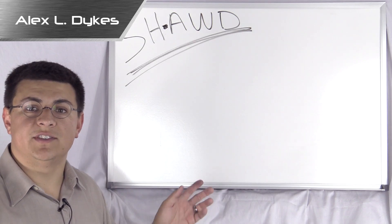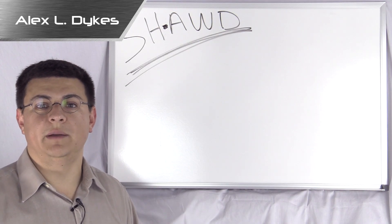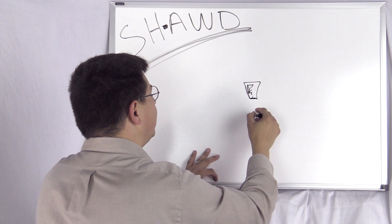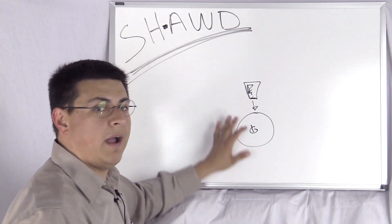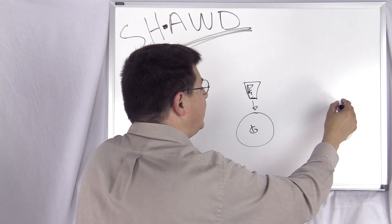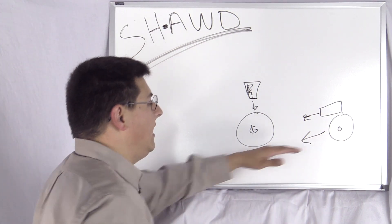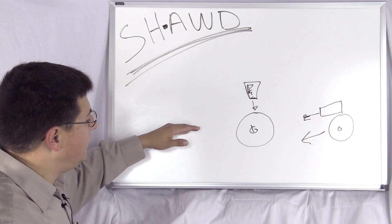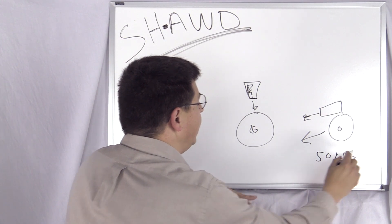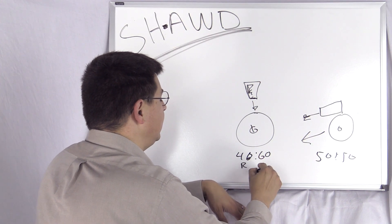I've had a number of questions recently about Acura's Super Handling All-Wheel Drive system and how it differs from the rest of the competition. Last week I had a video out talking about weight balance. In that video I said that basically front-wheel drive oriented systems have the engine right on top of the front wheels. This is very different from a rear-wheel drive layout where the engine block is positioned further back, causing weight balance to shift aft of the front wheels. This is how rear-wheel drive cars achieve a 50-50 weight balance, while many front-wheel drive cars tend to have more of a 60-40 weight balance — 60% up front and 40% in the rear.